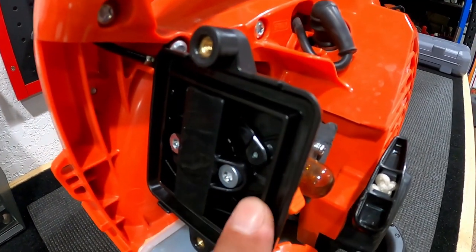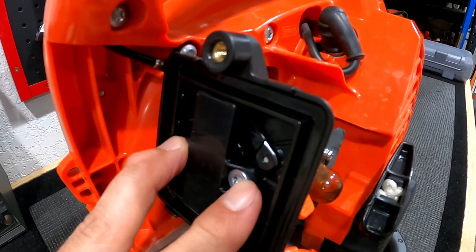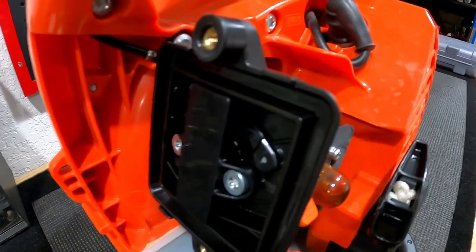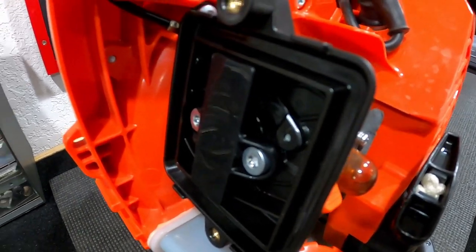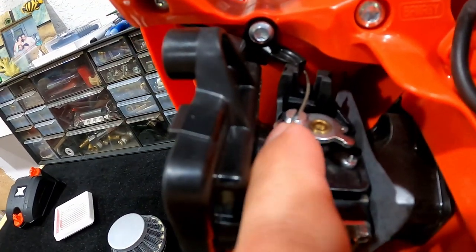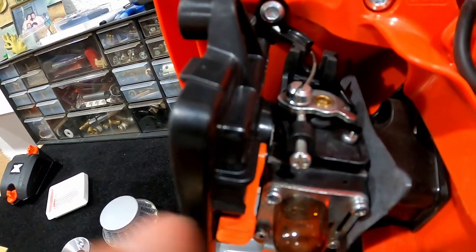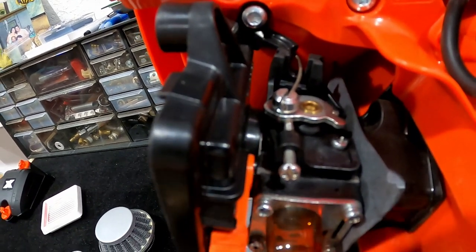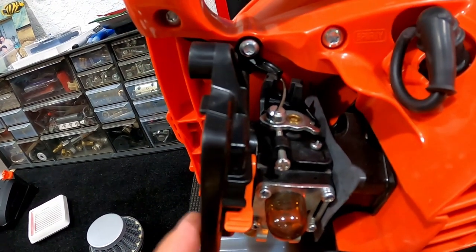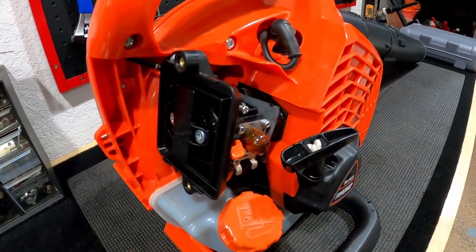I'm going to be removing this. The distance between here and here is about 31 millimeters, so I found this kit so I don't have to make any changes. There's only one little issue — this little metal tab from the accelerator touches the aluminum when you accelerate. I'm either going to put a spacer on it or grind it a little bit with the Dremel. Either option will work, and I think it's going to look pretty cool.